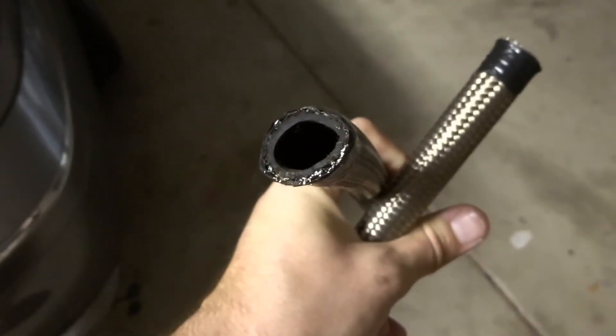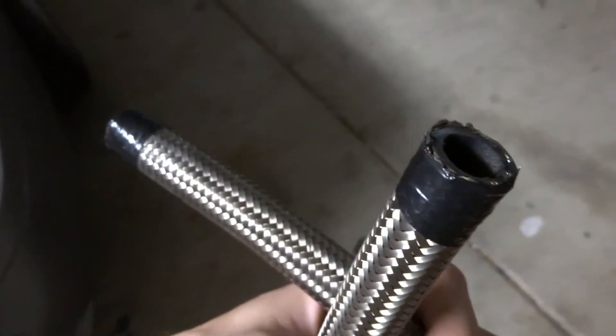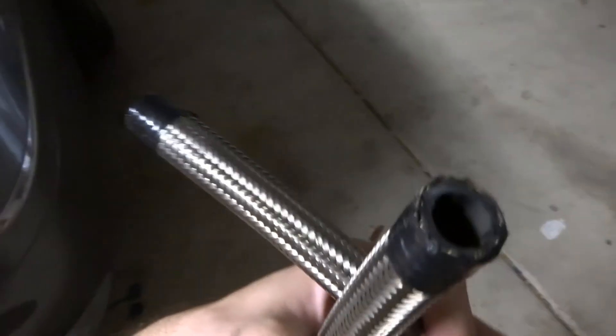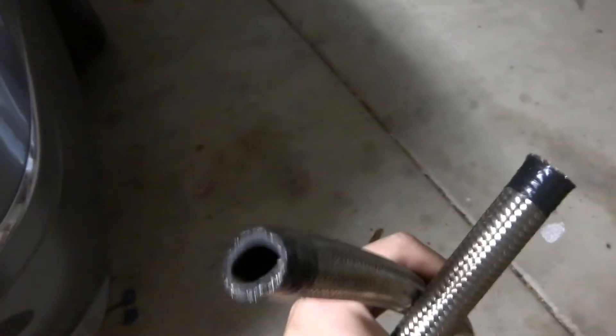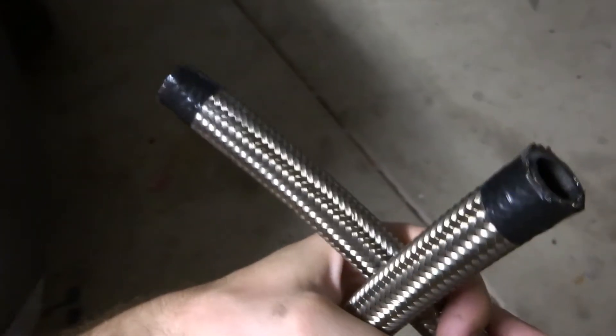Tape those flat, and there will probably be a little bit of metal fray sticking out, especially if you've had to cut this using a cut-off wheel or a hacksaw. Use some metal shears and try to clean up the little excess metal wire around the edges as much as possible. They'll stay out of the threads and keep those from hanging up when you're trying to twist the fitting on, and stay out of your fingers when you're working with it.